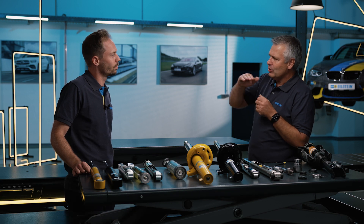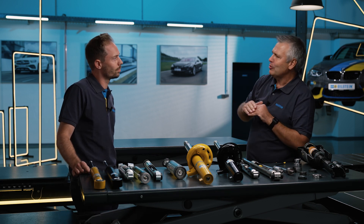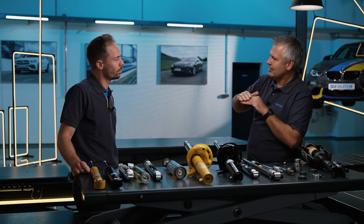In the workshop, on a suspension tester, a new car with this system might only show damping values of 30 to 60%, far below 100%. You have to know what's inside first. The suspension tester can't show 100% because it would require an extreme stroke, and between bottom dead center and top dead center the setting would still read as too soft.